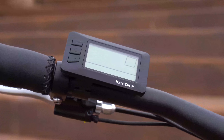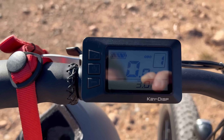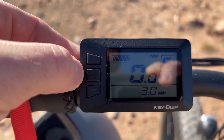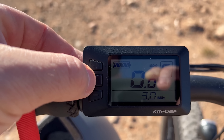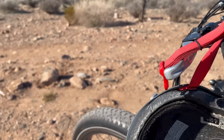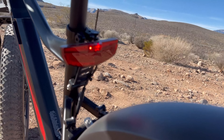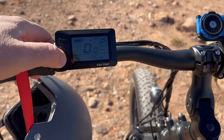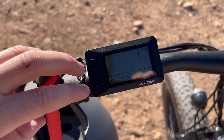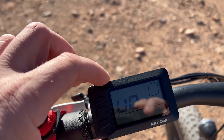Here's an overview of the backlit LCD screen — it's on the left side with the power button in the middle. Hold that down for a couple seconds to turn on. It's not the brightest screen I've ever seen but I can definitely see it while riding. You have a plus and a minus to change the pedal assist levels — zero to five, and that will go up to nine if you like. Hit the power button to switch through different readouts: trip time, odometer max, odometer average. Hold down the plus button to turn on the lights — there's a 48 volt headlight with a very bright front light and also a rear tail light that lights up when you hit the brake levers. Hold down the minus button for walk assist mode, which tops out at three miles per hour and stops as soon as you take your hand off the button. To access settings, hold down the plus and minus button — then scroll through by hitting the power button. I'll have a link in the description on what you can change and how to change it. There is also a red button that disengages the throttle.